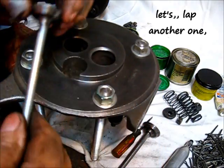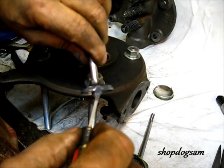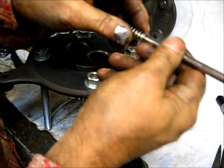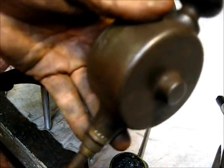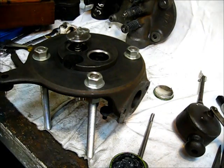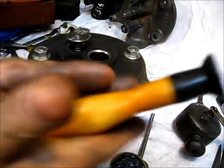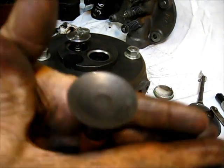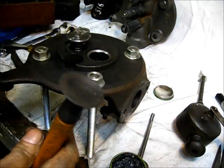When I wash these up and put them together, I'll put some light oil on the stem and a little bit of the valve grinding compound onto the seat area — doesn't take a lot. If you don't have one of these back-and-forth rigs, a good choice is one of these suction cup things right here. The way you use it is you go backwards and forwards — it never makes a full turn. Several different models of that, they're really cheap. The beauty of it is you can also lift it up off the seat occasionally.